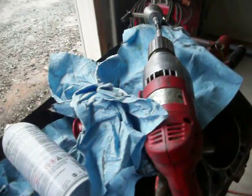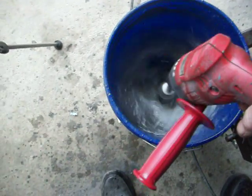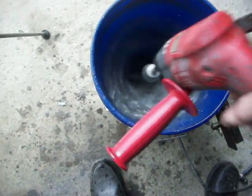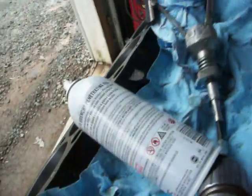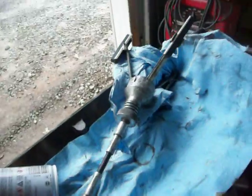What you're after is one even surface. After every 30 or 50 up-and-downs, put the hone in the water — just squeeze it and let it do its thing. It'll clean itself off pretty nicely. Then dry the stones just enough by touching them with a towel, and spray penetrating oil on there. You would be surprised how fast this works and how good it works.